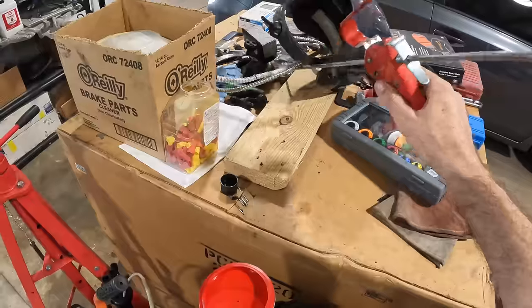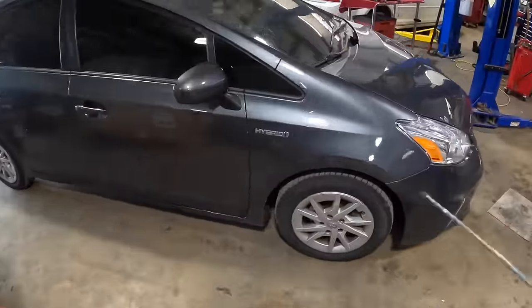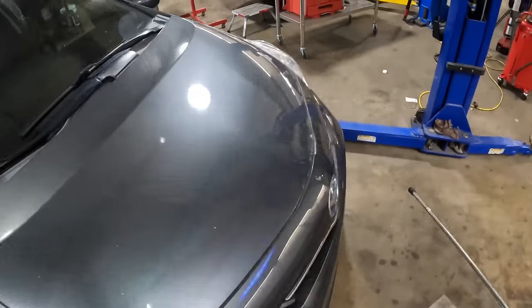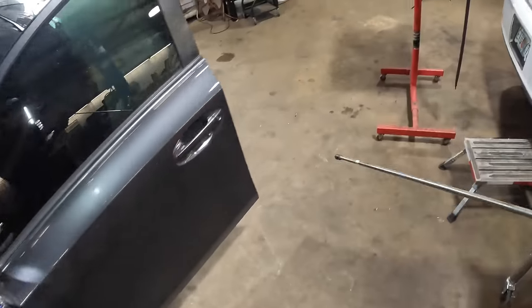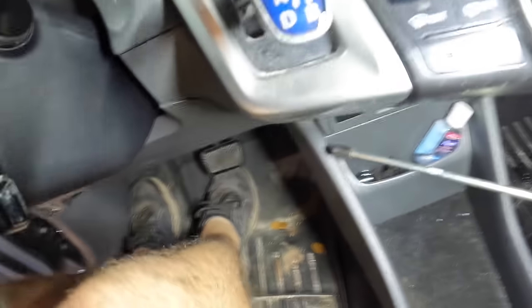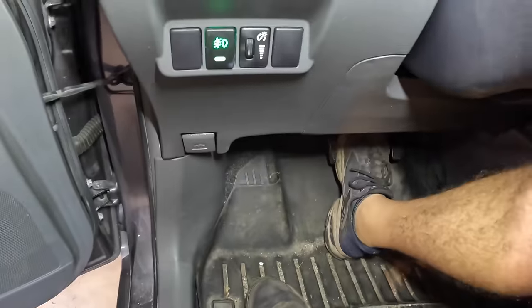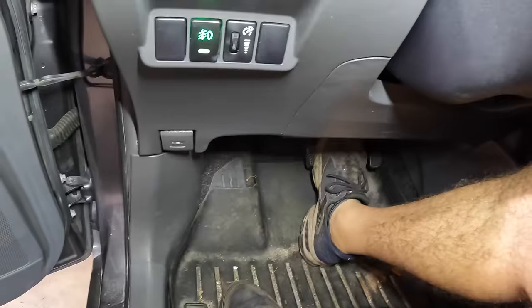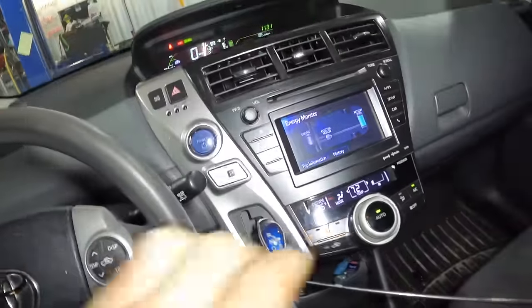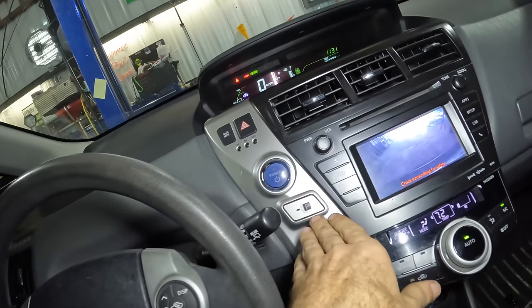Here, I'll tell you what, I'm gonna bring the brake pedal depressor with me. That way, while we're out and about, if we can get that brake pedal buzz to restart, we can hold the pedal down with the tool and then jump out and see if we can identify exactly which component is making that noise. I believe this thing has some kind of electronic braking assist motor, and when that motor is actuated, that's what we're hearing here. So let's go ahead and get this out into the real world real quick.